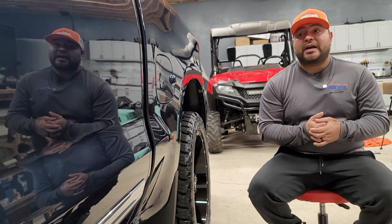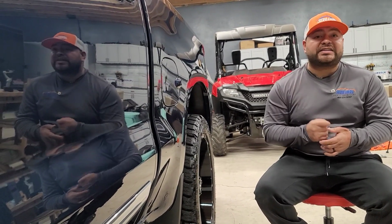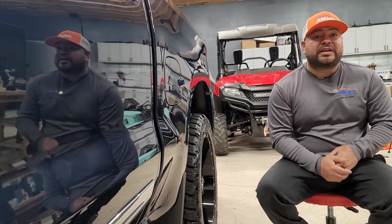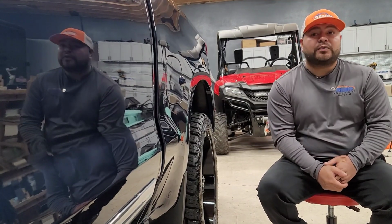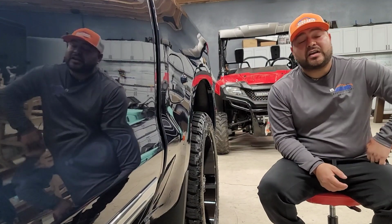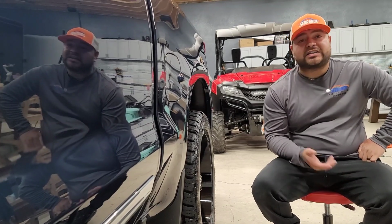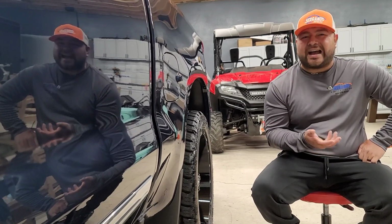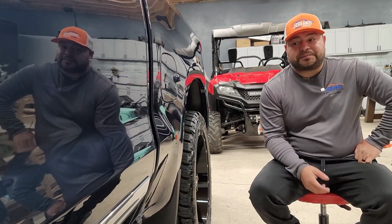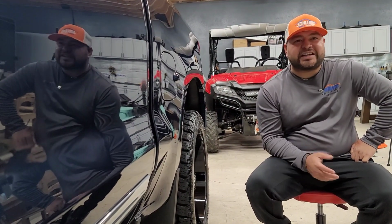And we used the Max Shine M15 Pro and Rupes Yellow Foam Pad paired with the Koch-Chemie M302, which is their finest cut polish. It fit perfectly for this scenario on this brand new truck. Overall, time wise, I think we've been here maybe 6 hours at max. Could it be done in less time? Probably, but we really don't want to rush anything.